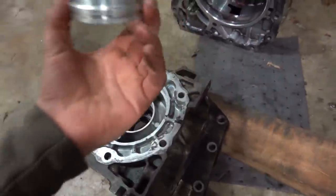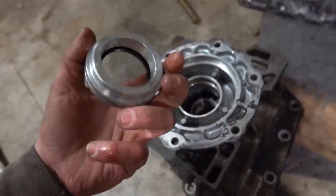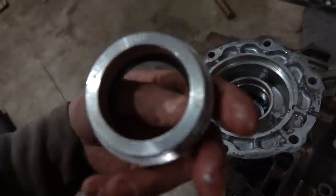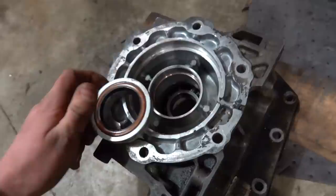Mike was correct — this is just a little extension spacer. I popped it out with a brass bar and a hammer, much easier than using pliers. That was the big trouble last night. I didn't know that — I thought it was a difference in transfer cases that was the problem, but it wasn't. It was that this transmission came out of a truck that apparently had a lift kit. Mike, I really appreciate it. I left the post up and edited my comments on Instagram. I'm all about learning — I made a mistake and I'm happy to show people my mistakes so you won't make them. He's 5.9 Mike on Instagram.